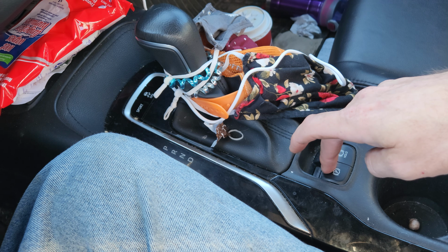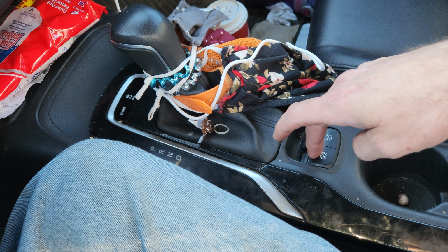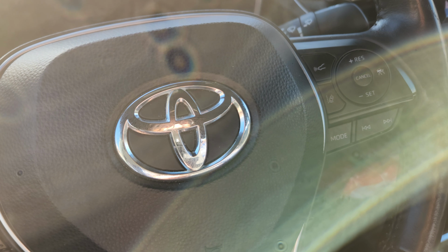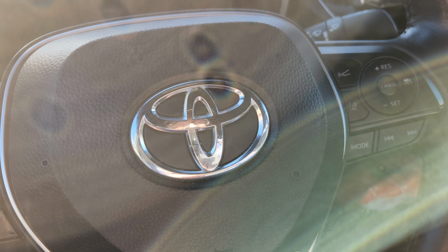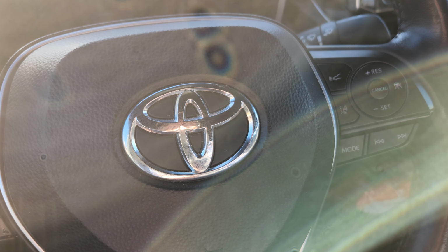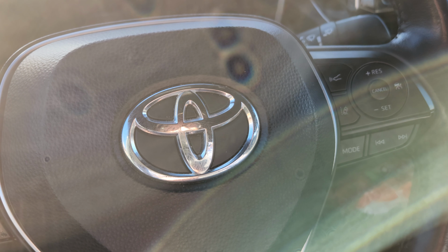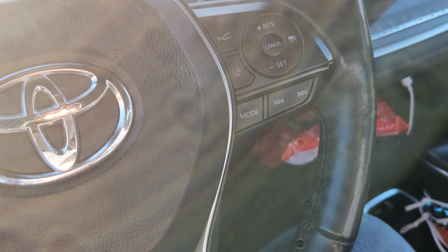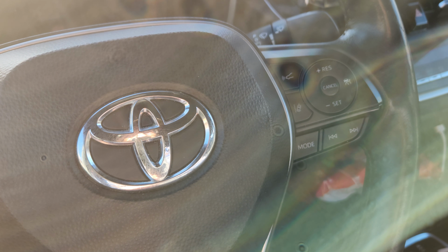That's when you push down on the button and hold it for quite a while, and you will hear the electric motor backing up. I'm sure you're all used to the sound of it. It takes like 2 seconds to engage the parking brake. When you're releasing it and you press the button down, it'll be more like 10, 11 seconds. Well, it fully backs out,